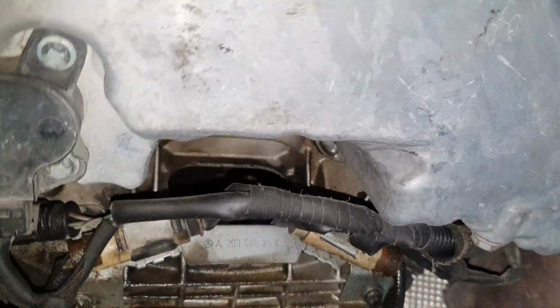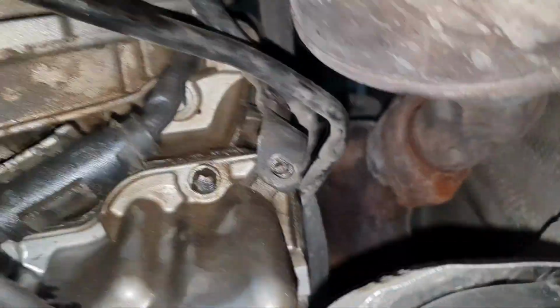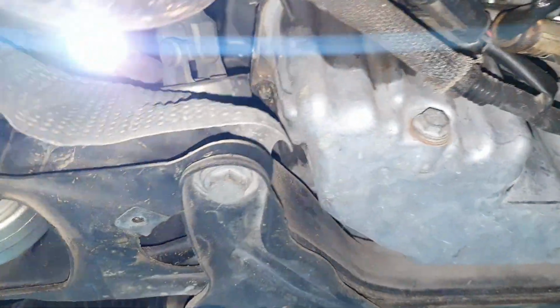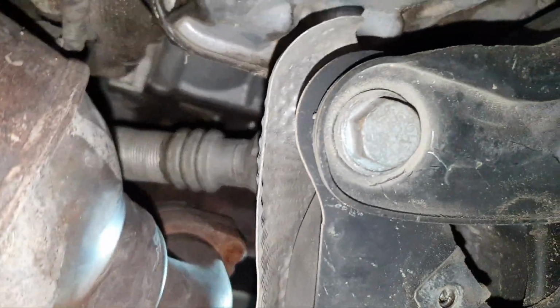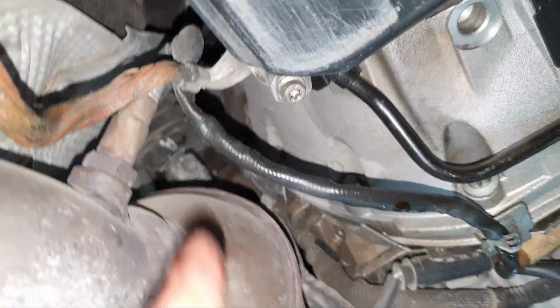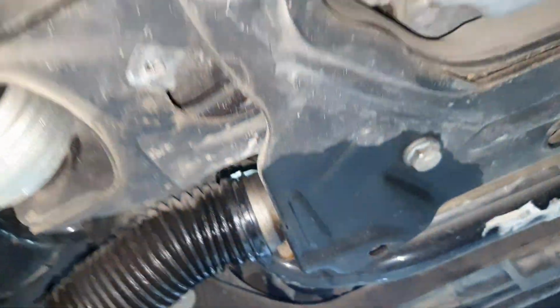I'm just watching inside the torque converter. Alright, then, yeah, there is a leak from the cover, cylinder head cover. It's missing the bolt from the pipe for the power steering. Somebody was there. It's leaking also this. One second to see. Yep, it's leaking also this cover. Both the ground's okay, the ground's okay.